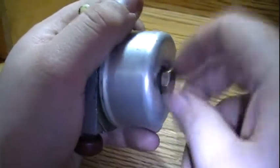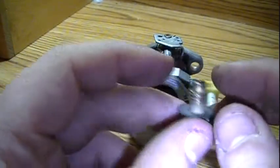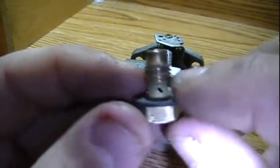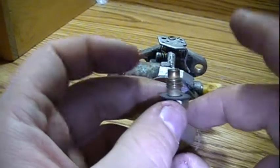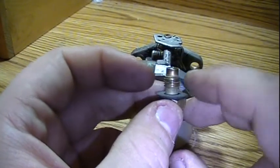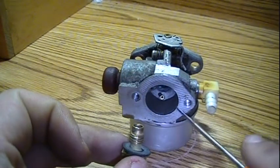Now we're going to remove the bowl nut here. This is a jet — it's also the bowl nut. The way that this works is when the fuel comes in, it would go through these passageways. You can see there's passageways on each side of the jet, as well as a small one there and one in the center. This would connect to an emulsion tube, which we'll get to later on. The fuel would be sucked in through here and go straight up into the venturi of the carburetor.